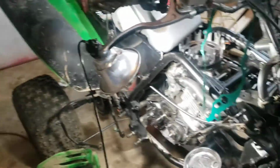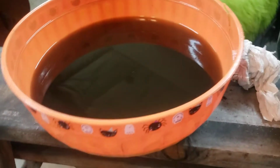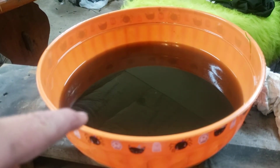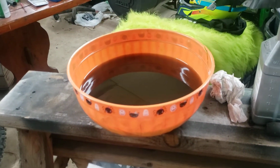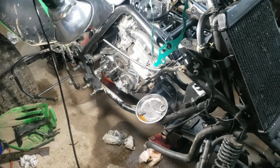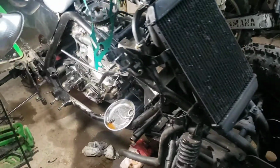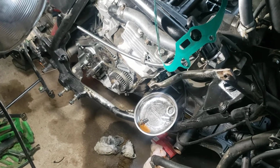I'm kind of disappointed that I wasted $50 worth of oil. I think what I'm going to do is an old trick and take a little hand strainer with a handle on it with a strainer basket, and put a coffee filter in there and try pouring it through the coffee filter and see if I can't get the solids out and clean up the oil a little bit, seeing as how I just put it in there and ran the thing for 5 minutes. So see if I can't clean the particulate out. I might not be satisfied with it. I might just trash it and put in fresh oil. So I don't know. Over time it's gonna get nasty anyways, so the blackness doesn't really bother me that much. It would just be if there's any solid stuff in there.